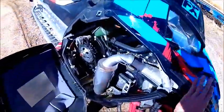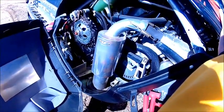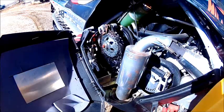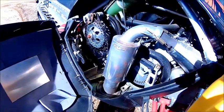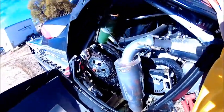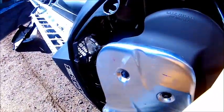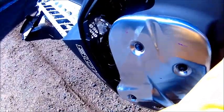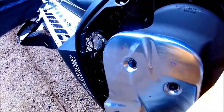Obviously I don't have the stock muffler — I have an HPS can on. On my 2017, I'm going to be putting a GGB can because they are the loudest there are. You can see the chain case. The chain case is a lot more durable than the belt drive. I've never had any chain case issues. With the belt drive, if you're ever in the air and land with the throttle pinned, there's a good chance you can snap that belt, so you've got to be a little more cautious.